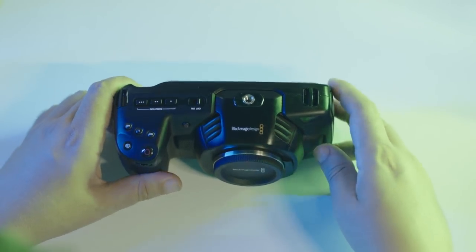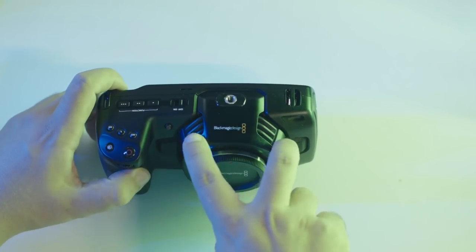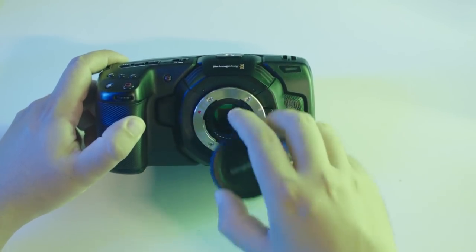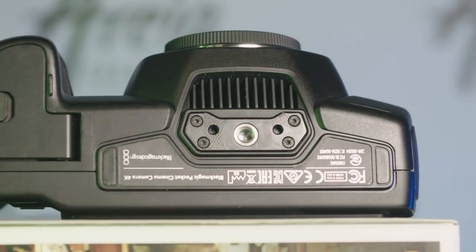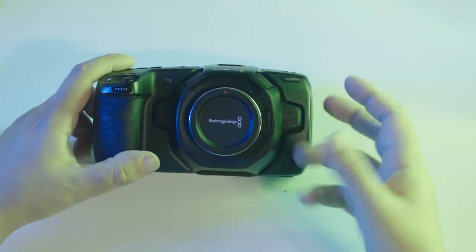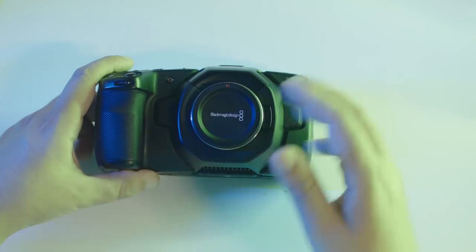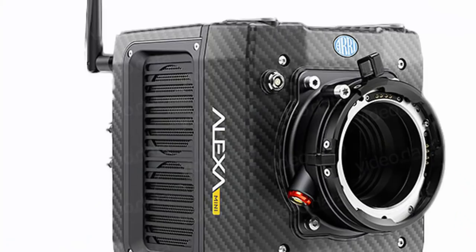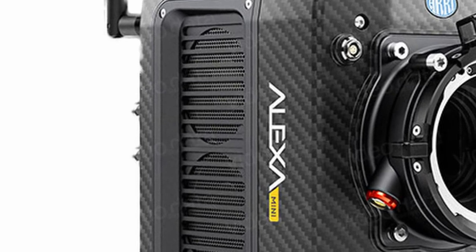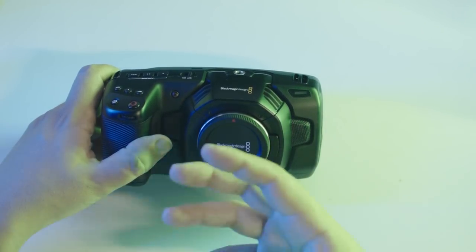The camera has an interesting and quite obvious ventilation system. The way it works is that the top vents suck the air in, the air goes through the electronics and especially the sensor, it absorbs the heat and then it comes out of the bottom vent. This is really important for keeping digital noise levels down, as hot camera sensors usually result in noisier images. On the other hand, there is some audible noise coming from the ventilation system, which I can hear clearly when I put my ear near the camera. Such cooling systems are very common in all kinds of cinema cameras. The original Pocket Cinema Camera didn't have one and didn't work that well since the camera would heat up quite quickly.